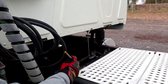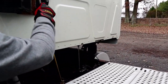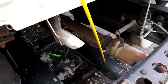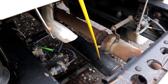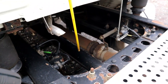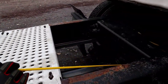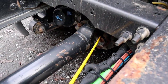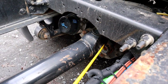This here is our driveshaft — properly mounted and secured, not bent, cracked, or broken. We have U-joint knuckles on our driveshaft. These are our U-joint knuckles; they should be properly greased and free of debris.